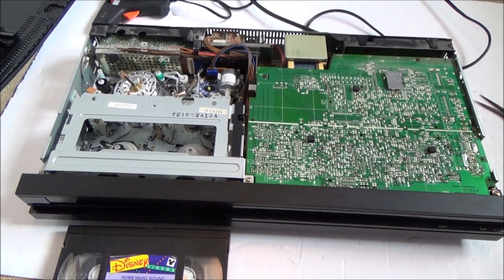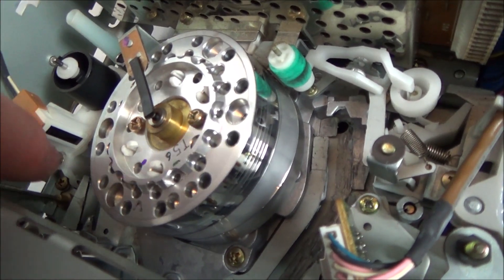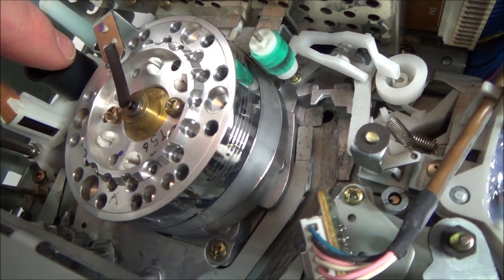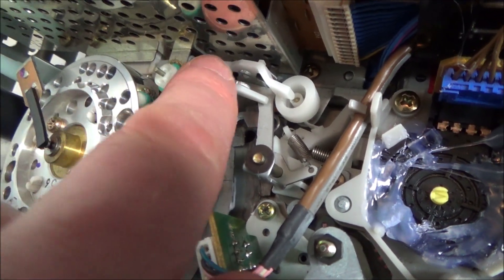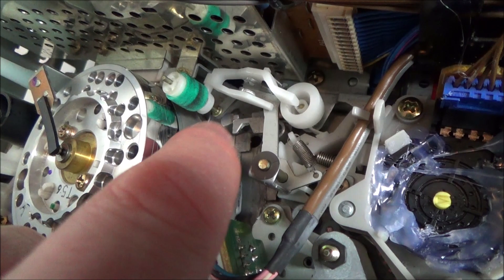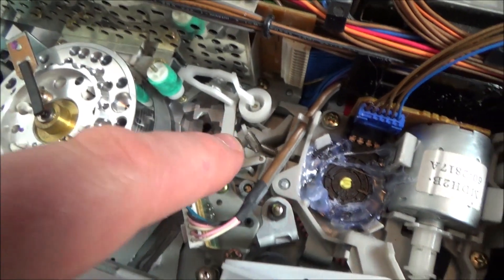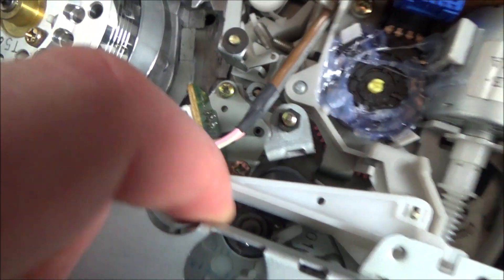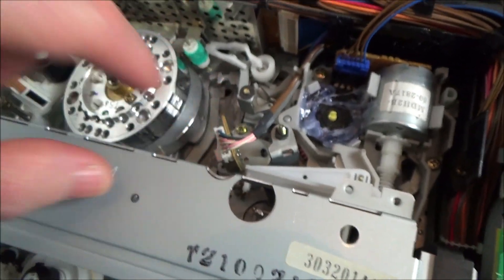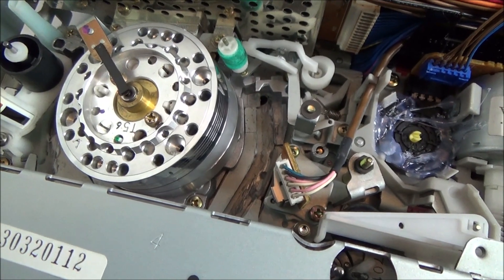Let's get this back together and put it on the proper TV. Before closing up I'm going to get some IPA and clean with cotton bud Q-tips everywhere the tape goes. I'm not going to touch the tape head — it seems to be playing really well. However I will try to clean up this pressure pad — it gets pushed against the tape head and you can see there's a lot of dirt there. Also the pinch roller and the capstan — I'll give all of them a clean. I've already put grease on the main tracks where the rollers come up and down.